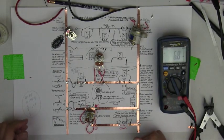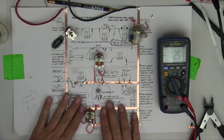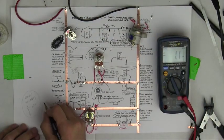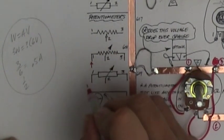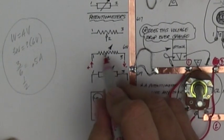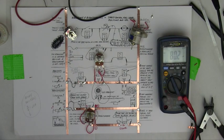So what I can do here, just to prove a point, just using the voltmeter — circuit's turned on. So current's actually flowing through terminal one to three, flowing through here. So here's my potentiometer right here. Current is actually flowing — whichever way you like current flow, I don't care about the direction. If you think current flows from positive to negative, that's fine. And this resistor is heating up and is dropping all 12 volts in this case.